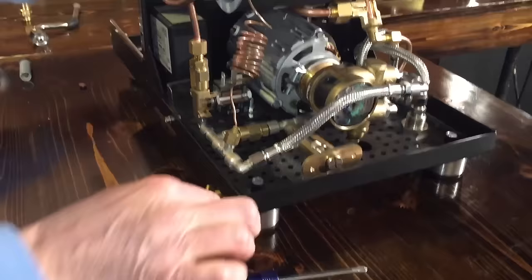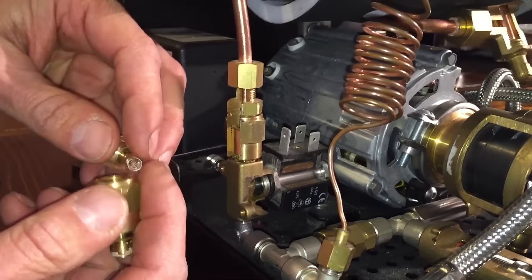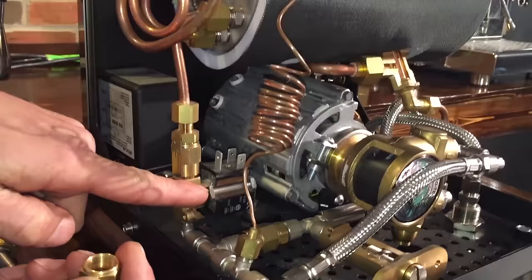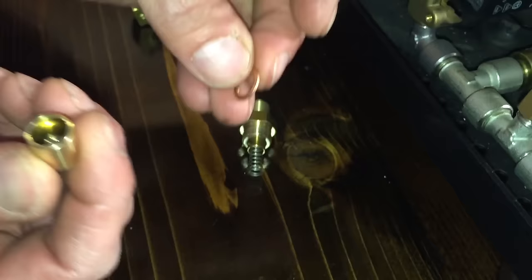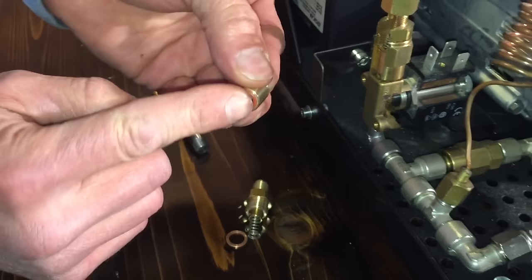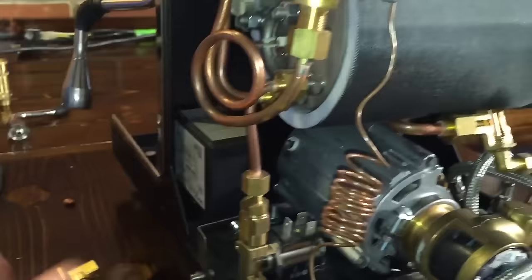So let's move from the solenoid valve through to the check valve. The purpose of the check valve is to keep water from the boiler pushing back down to the solenoid valve going the opposite way, where it could actually open that solenoid valve. Inside here you've got your spring, then a little metal washer and a ball, and inside there you have a valve seat. That drops there — water goes this way and can't get by it. There's another little valve seat, so when that drops in, it seals real nice. Once we get through this check valve, we go directly into the boiler. It fills that up.